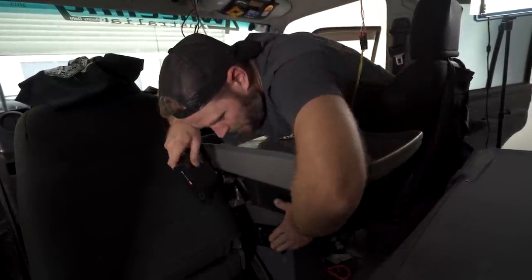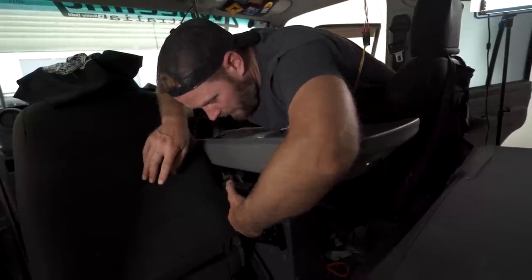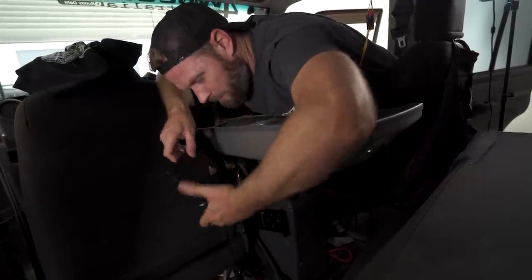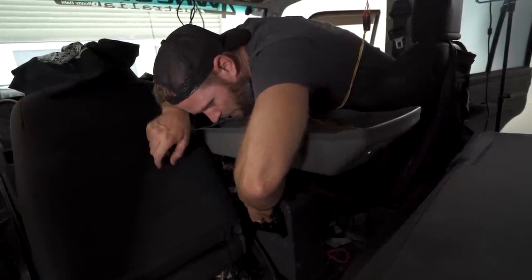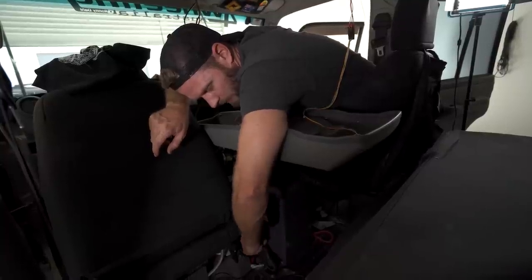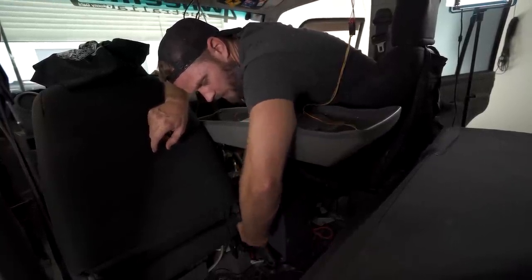So down here, I'll put the bracket on an angle. Now you won't see it, because brackets on an angle will actually be quite ugly. So I'm going to spin it this way. The reason why I put the bracket on the angle is because of the seatbelt right here. So I wanted to avoid this being too close to the seatbelt, otherwise the seatbelt corrugations, whatever, got a passenger, it's going to come up and rub on a cable.